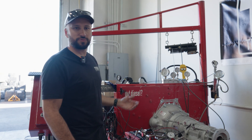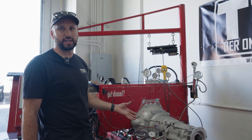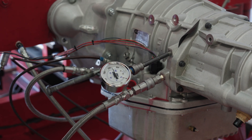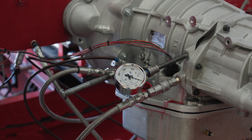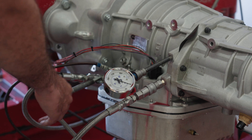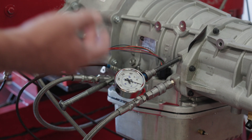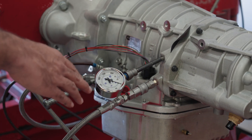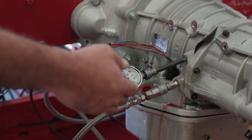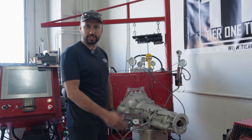This valve body is designed to have lockup in second, third, and overdrive. Overdrive can also be applied in any gear in this transmission. Overdrive in first gear, overdrive in second gear, back to third — if you get overdrive in third gear by the PCM applying electronic ground to the solenoid, it still functions the same way it would in the truck. So you can use overdrive on any of our full manuals with the transmission you have built. We'll drop it down into first gear to test the trans brake now.